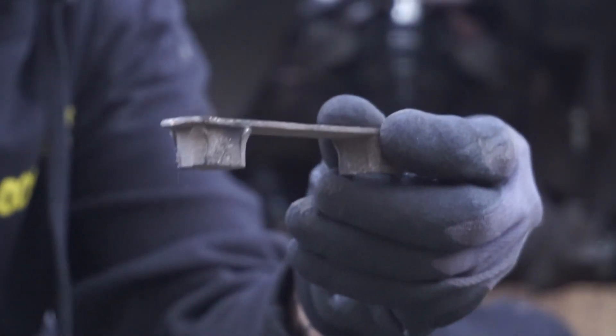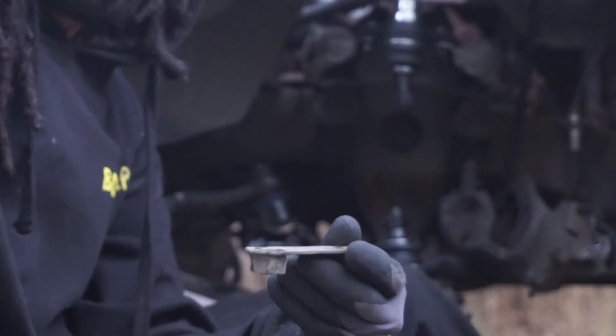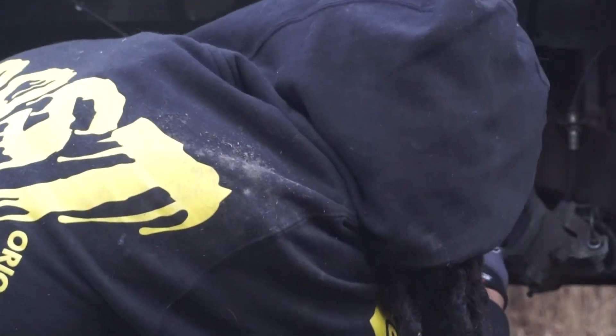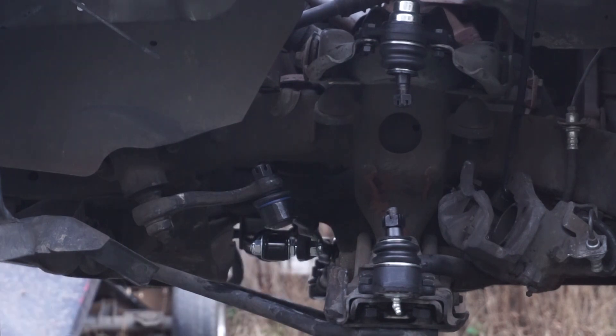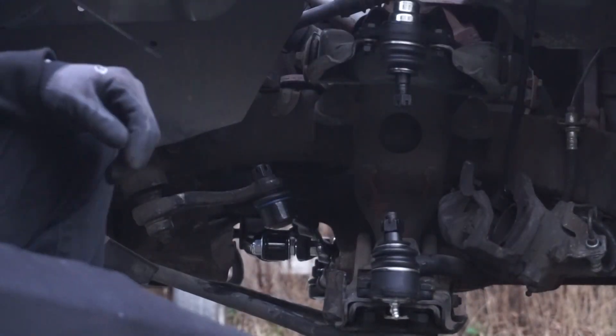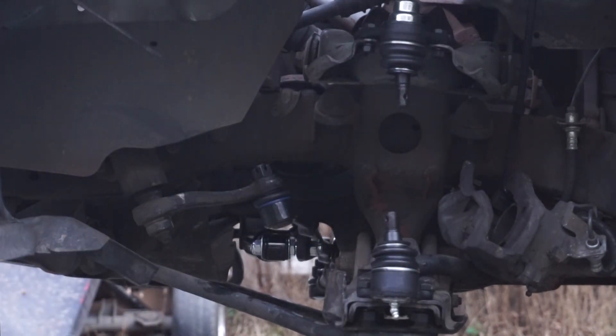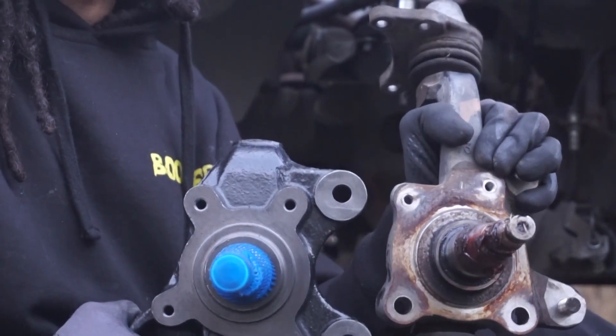For the ball joint flip: this retaining piece usually straps over the top of the ball joint, but we're installing it on the bottom of the radius arm instead. Since it can no longer sit on the top part, instead of running the nuts through the bottom, you're going to run them through the top. Here's the old spindle to compare in size — basically all they changed is the pickup point, dropped it about two inches, and that made all the difference.